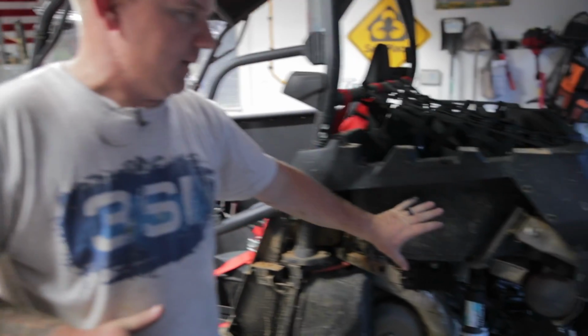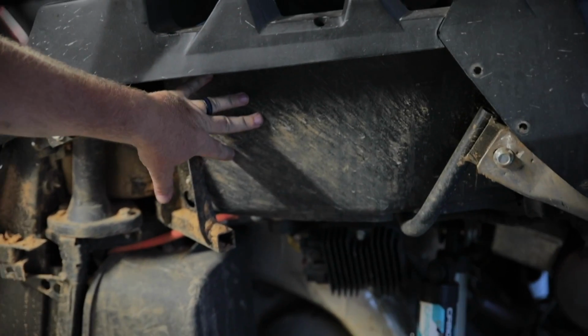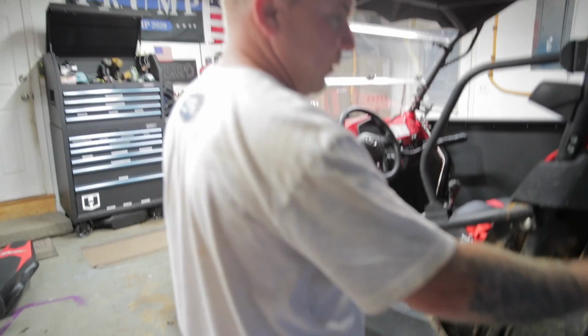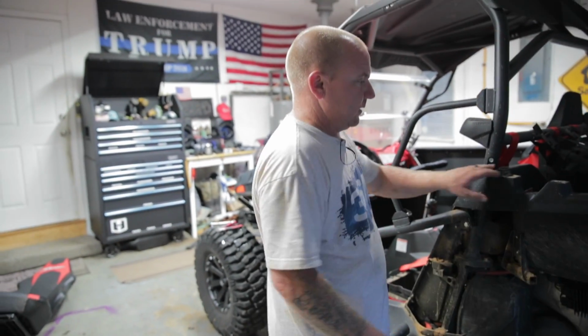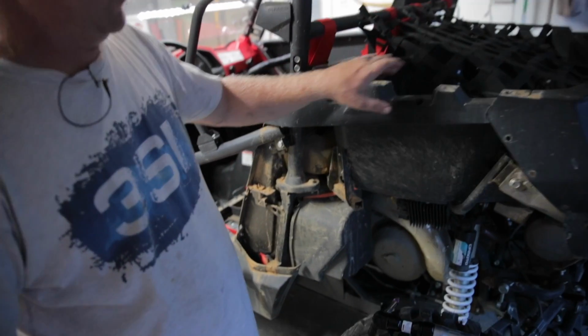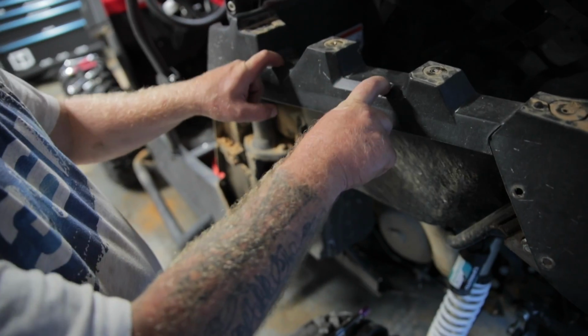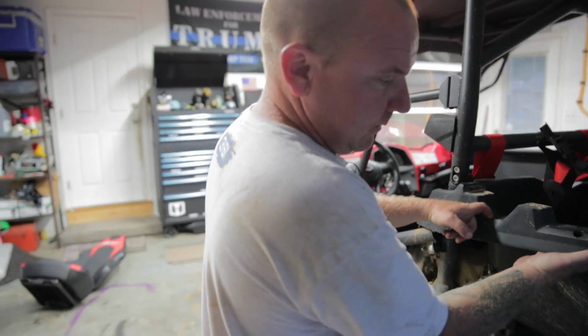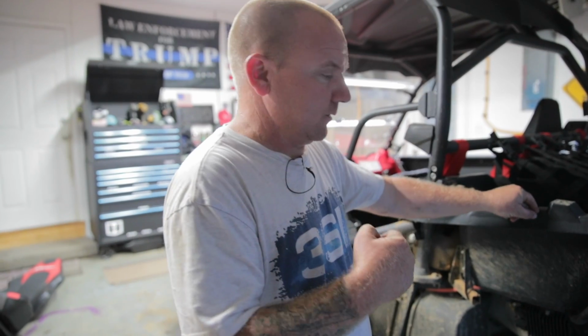We've removed the back, what I call a fender. We've also removed the front fender, both fender flares, and this rail. And not only do you have the 4 in the rail, but you also have these 2, so don't forget to do these 2, which helps the fender stay up as well. Suggest hand tightening when you put them back on.